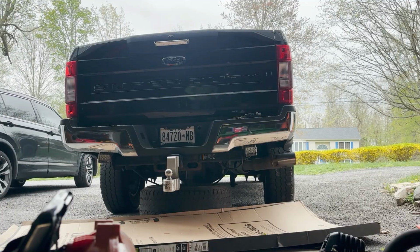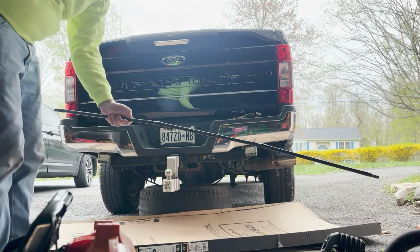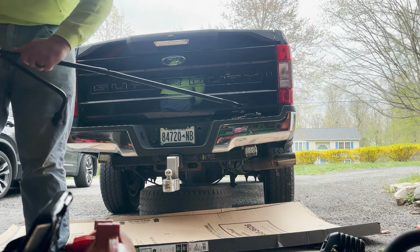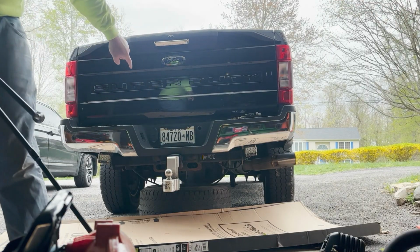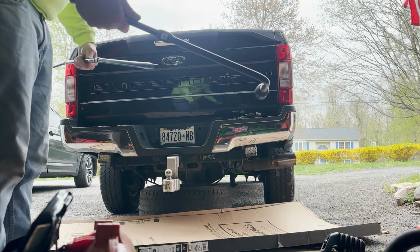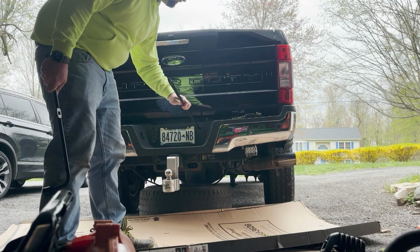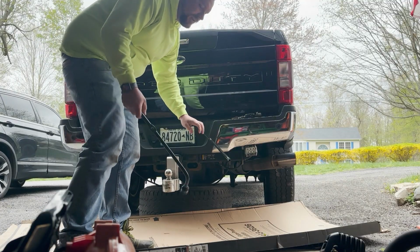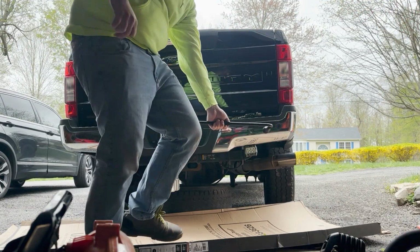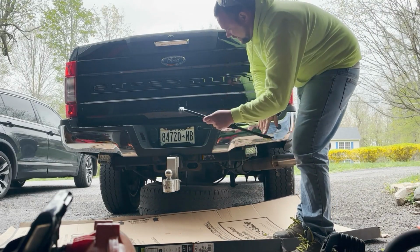In your spare tire kit, you're going to get a series of 3 of these things that connect together. One end is kind of curled off, like there's a little hook in there and it grabs on. Then you take your tire iron, and in the middle there's a square. You just kind of plug it in like so. So first, in the hole here, you're going to insert, feel it catch. You're going to put this in like so, and then we're just going to twist to pull it up.